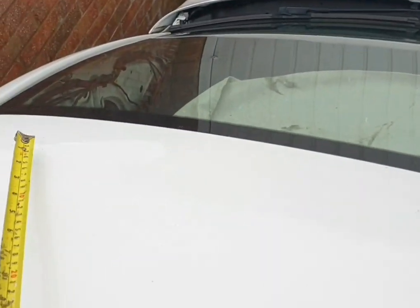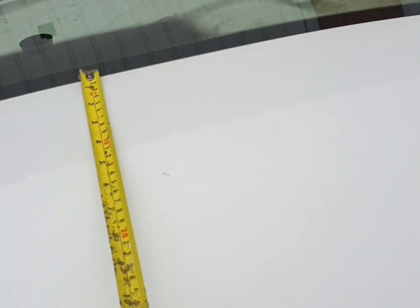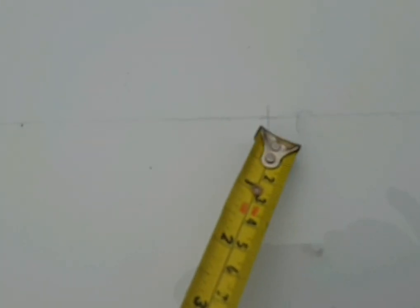Right, we're now up on the roof, in the front of the van. Now, well, you can see my pencil mark, sort of drawn it out. I have to get these marks. We've got to measure the distance of the windscreen to find the centre. So from over this side, get the centre. Then we've come back 450 mil, which brings us here. And then I've got my level. Once I find my centre there.